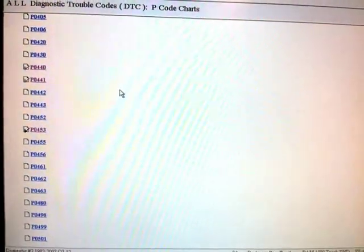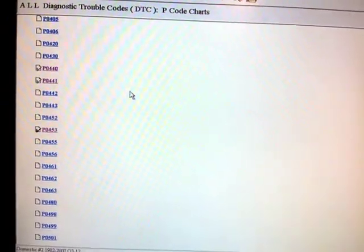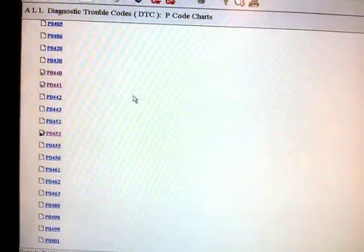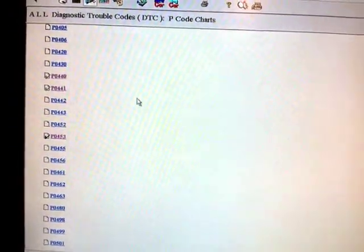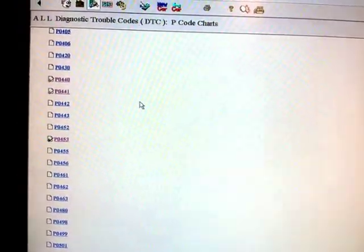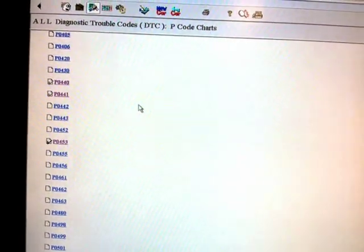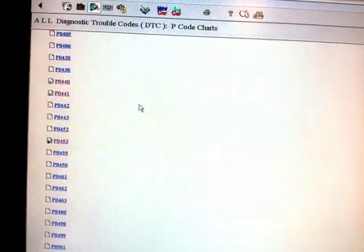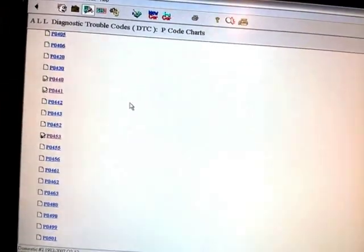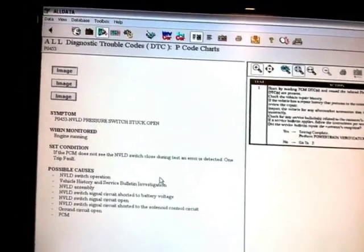Alright. Hello YouTube, this is an extra clip to this part 4 video, Evap Diagnosis. I want to correct myself with the information I put out there in part 3 and 4, saying that the main cause of this NVLD pump being faulty was due to a stuck open switch. If that was true, we would have had a P0453 code, which I'm going to show you right now, which says NVLD pressure switch stuck open.